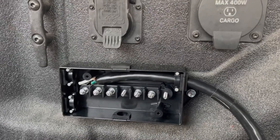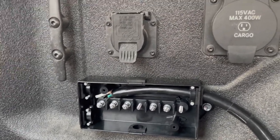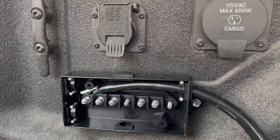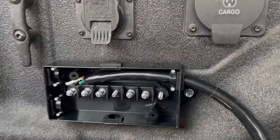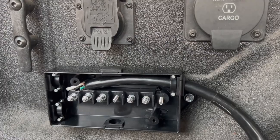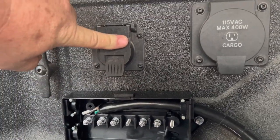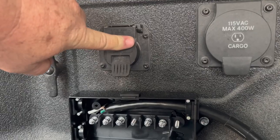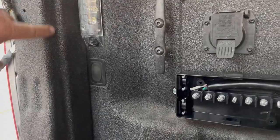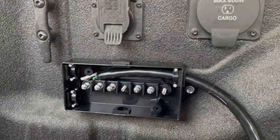When I hit reverse I can have a light bar on the back and light up everything really well, or backup lights that go into the bumper. I'll just wire them up through here, which is a lot easier than splicing into the factory harness. That way I'm using the original trailer plug wires, which are specially fused and on a separate system, rather than tying into any of the brake lights back there.